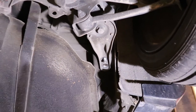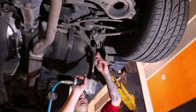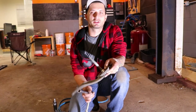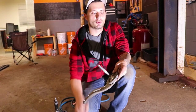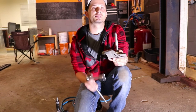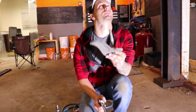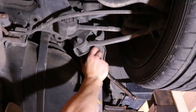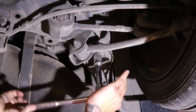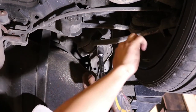After you get those off, move to the 19mm bolt and remove it. Now I'm going to take the bolt, put it on a wire wheel, and clean off all the rust and corrosion at the base. The collar is going to slide on the bolt — this is the bottom of the plate where the bolt head is, and the collar slides on top. Then I'm going to take it with the ratchet and ratchet it back in by hand, being very careful not to cross-thread it. I put my hand at the bottom and very gently thread this bolt back in, constantly applying upward pressure so it doesn't cross-thread.